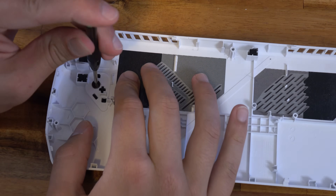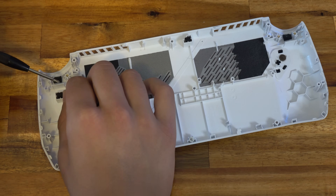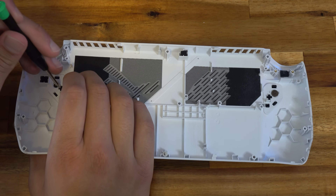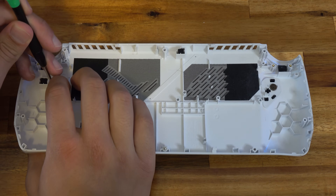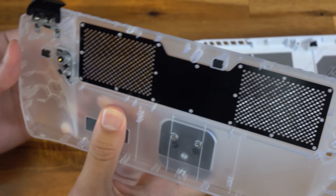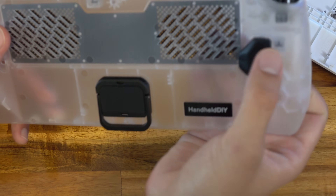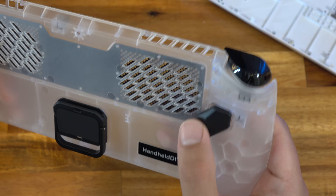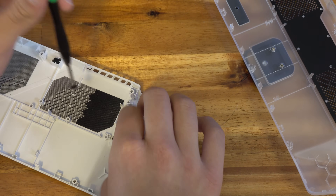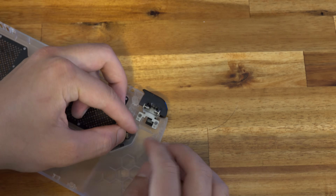For the paddle buttons, these are a little bit more tricky. They have disc-shaped screws that you need to take off, and there's a little spring underneath that might fly out when you do that, so just put that spring to the side. Inside there are a couple of little tabs you need to press in order to pop the button out from the other side — just use a screwdriver and press each of them and the button falls right out. For reassembling, do the exact same thing in reverse: pop the button into place making sure those tabs go through the correct holes, drop the spring into place, and tighten down the screw on top of the spring.